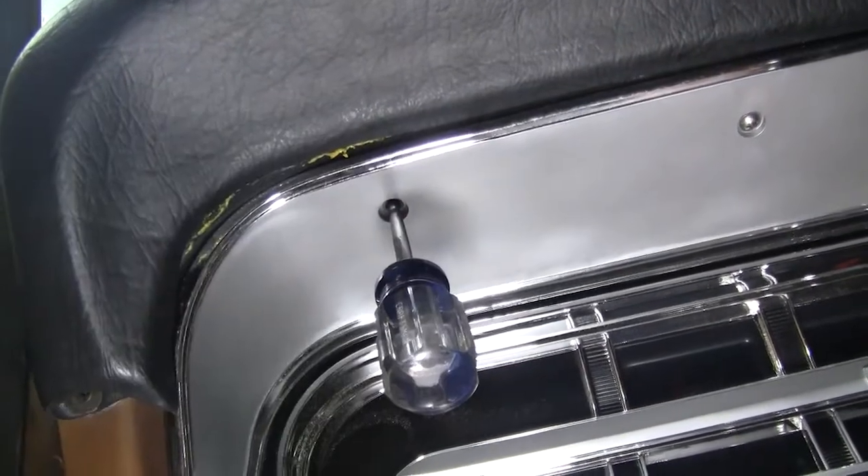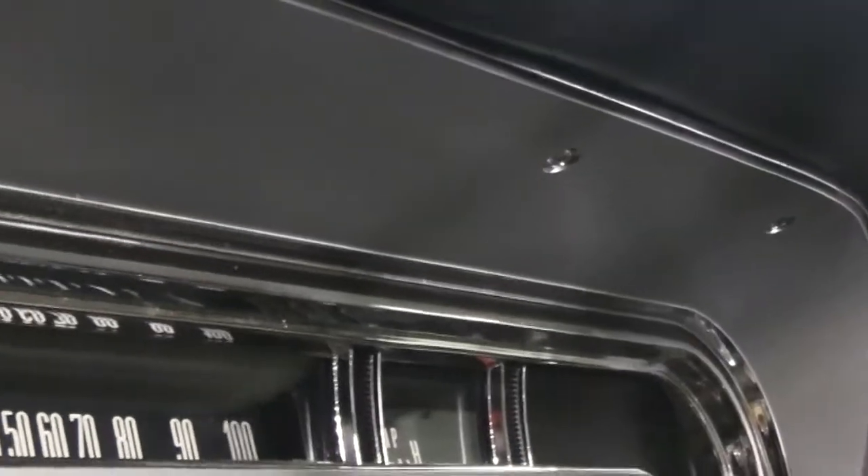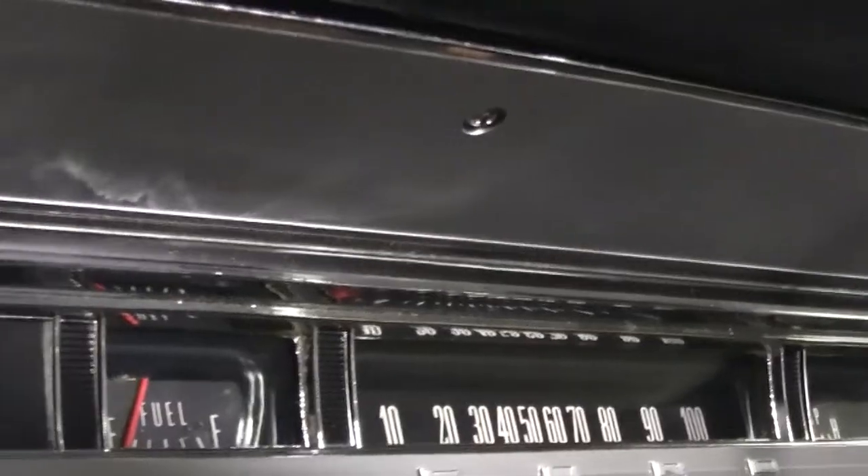Better than your eyeball can. In a lot of instances, you run this up in there, feel around a little bit, and when you find the right spot it'll run on in and you'll know that's the spot for the screw. A little pressure on the panel, put the screw up in there, but do not tighten that first screw all the way. Wait till you get all the screws in the dash panel before you tighten everything up, that way you can move the panel around if necessary.